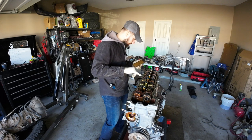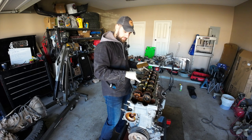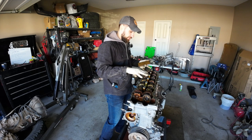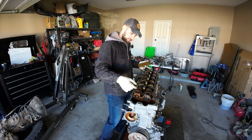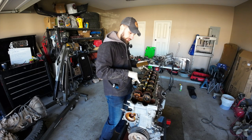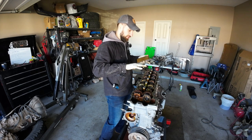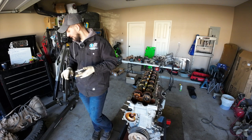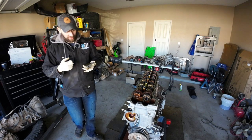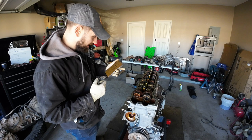So right now, for example, I have the rearmost and the second cam lobes being activated. If I were to take it off in this configuration, which I'm not, I'm going to put the bolt in the service port for the cam gear. I would loosen those two evenly so this whole thing comes off as straight as you possibly can. It's really important because you can break camshafts. Those of you that have ever worked on BMWs before and have made that mistake know those camshafts are really easy to break.